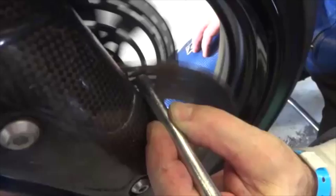Discs can get damaged, particularly when the wheels are out of the bike, like when they're being transported — your spare wheels or wets for example. It only takes a small knock on the disc to warp it or put it out of true. The effect can be felt on the track; the lever pulsates in your finger while you're braking, or you get a juddering sensation.